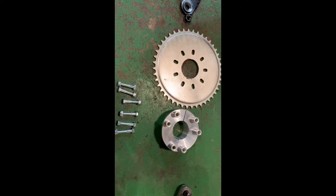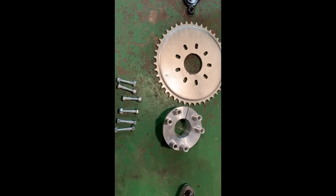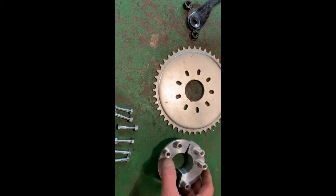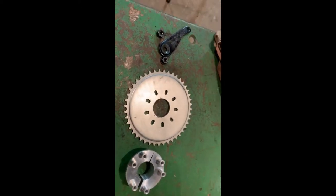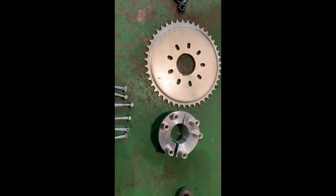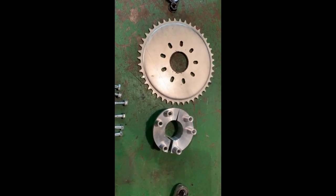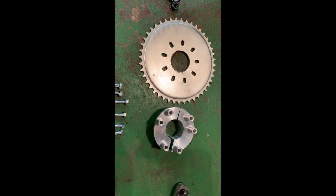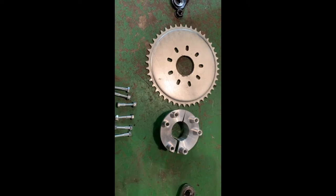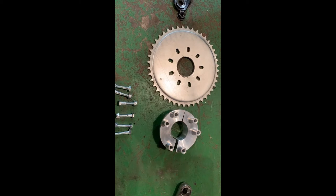Your second option for mounting your rear drive sprocket is the aluminum hub. It comes in two parts, squeezes on the hub assembly, is easier to install the bolts, and gives you a much truer turning sprocket — meaning straight, not doing the egg-shaped wobble or left-to-right wobble which could give you chain problems in the future. I'll show you how this one mounts up.